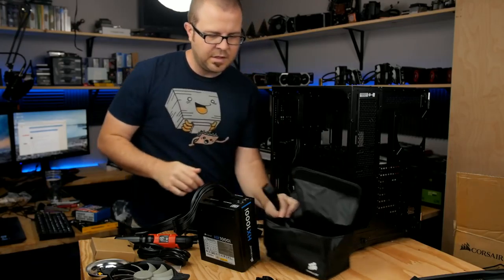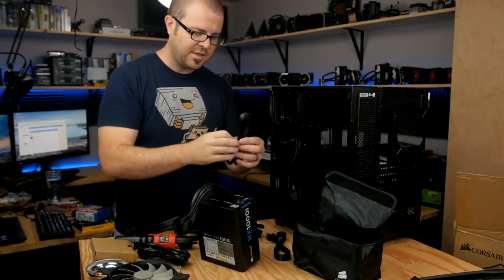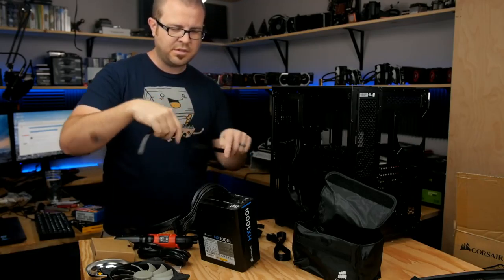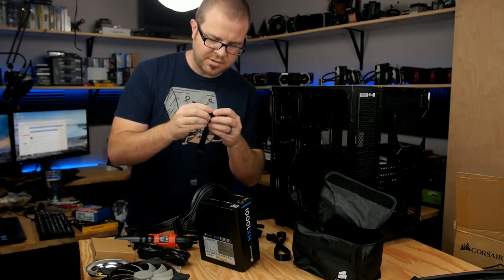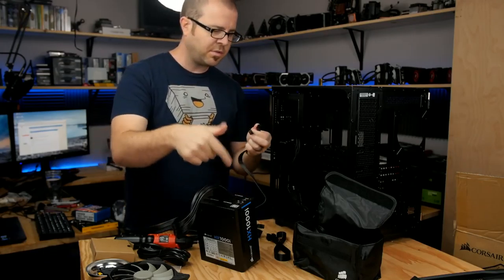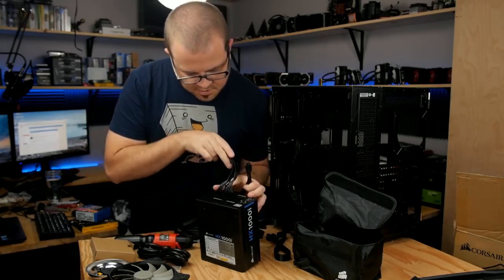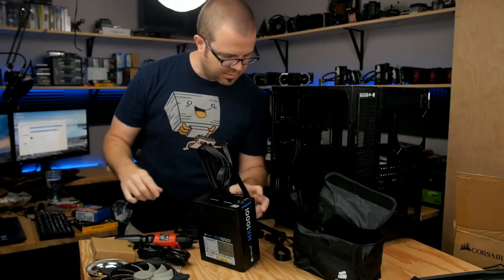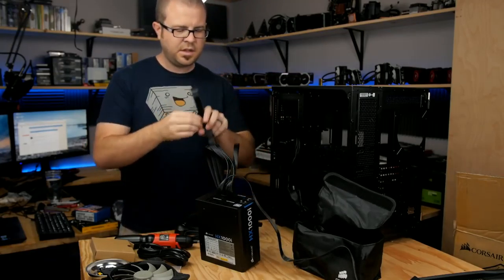Okay. It also has Corsair Link, so you might notice lots of Corsair parts in this build, and I should thank Corsair for sending them over. They didn't sponsor this video, but they did send me all the components to build the system with, the Corsair components at least that you see here. And the nice thing about using all Corsair components is you can use the Corsair Link software, which can tie into stuff like your power supply and the liquid CPU cooler to give you information about performance, temperature, all that good stuff. All right, so 6 plus 2 pin for PCIe as well as CPU. So there's one for the CPU. That's PCIe. Here's a second for the CPU.